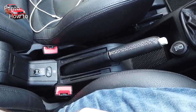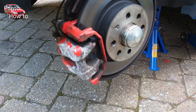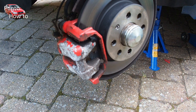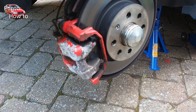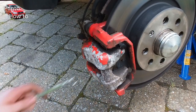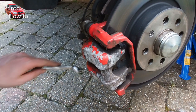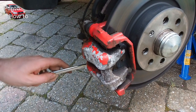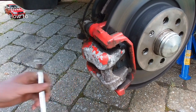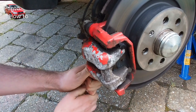From the factory Fiat decided to paint the brake calipers bright red, and as you can see here the caliper itself, although it's still got some remnants of red on it, seems to be missing most of its paint. The other thing you may notice is the dull dark color of the brake disc, because the original brake caliper had finally failed and was binding. The caliper was not releasing the brakes — when driving along the brakes were still applied, causing the disc and caliper to heat up to such an extent that it changed the color of the disc and caused the paint to flake off.